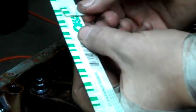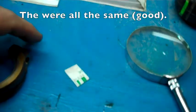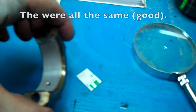Cut off a little section of this paper here. Make sure I'm using the millimeter side. I want to compare it — it looks very close to that one, definitely wider than that one. That's the closest one. The clearance is 0.038, and that's between 0.02 and 0.05, so 0.038 is good. That means these rod bearings are good.